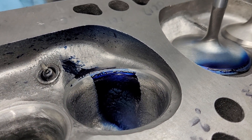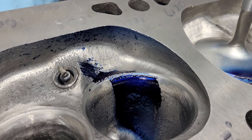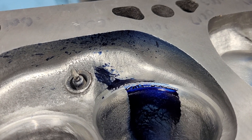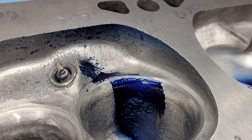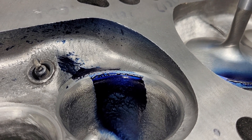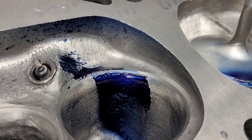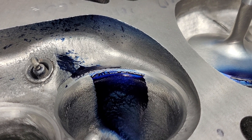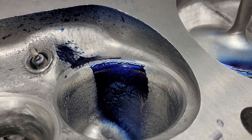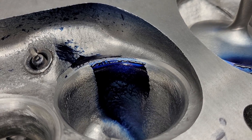Back on the Chinese EQ heads — this is the sixth cut. Some of the things we did: I gave it a little more bowl ratio on the intake, I gave the short side radius some layback, I opened up the straight wall and made it a little straighter, and I made the pinch a bit wider on the shared wall. Did it help? Well, that's an interesting question.